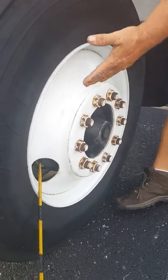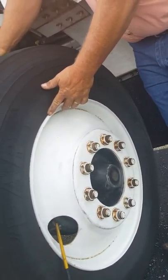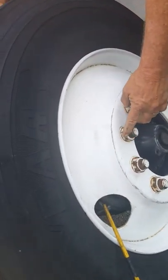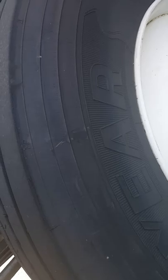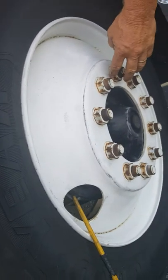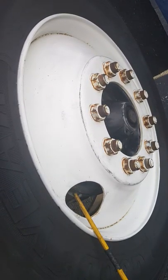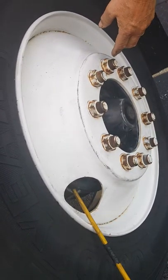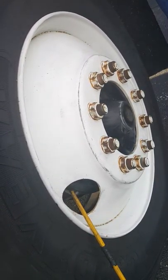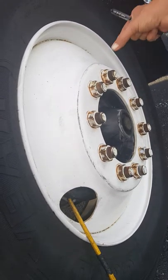Other than that, you're looking for any kind of bend where they hit a curb, or damage like that. Moving to my lug nuts — all my lug nuts are present and tight. I don't see any rust trails coming from the lug nuts that would indicate looseness. I don't see any oblonging of the lug bolt holes that would indicate the rim has been run loose.